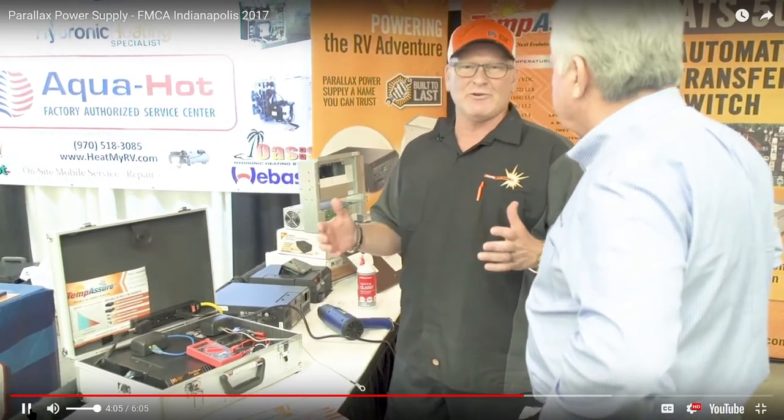Today's traditional converters are pushing voltage into a battery which is never good — if your battery's fully charged, it's force feeding it. That's what causes gassing and boiling and causes your battery to deteriorate. A lot of RVers have got a lot of things on their mind, so they're not tending to their batteries on a regular basis like they should. They should be checking the water monthly — sometimes weekly if they stay plugged in all the time. They should never be plugged in over two weeks at a time. They may not disconnect their battery, and their converter keeps charging. We get a lot of phone calls and emails about that.